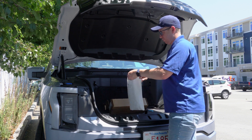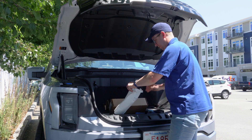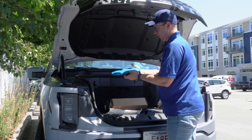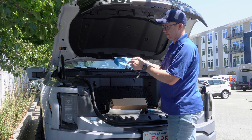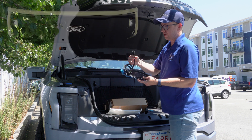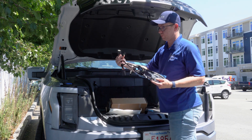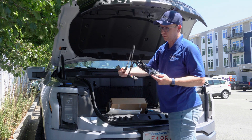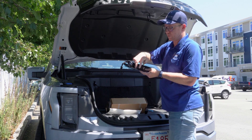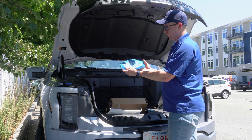So inside the package we have the emblem. Ford — the whole thing lights up white, illuminates via LED. In the back here, we have your connector that you're going to end up using instead of the T-connector. This conveniently does plug in here, but the other ones don't matter. What you're going to do is use your existing wiring setup for the camera in the knockout in the front, and then this is going to get wired separately.